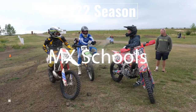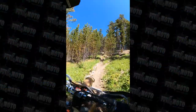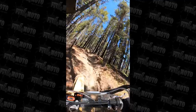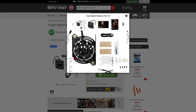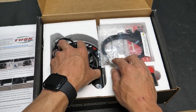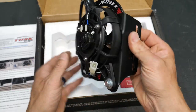That's all pretty handy stuff to me - it looks like it's easy enough to install. I've never installed one of these before as I'm new to the whole hard enduro bit. A few things that grabbed my attention with this digital fan kit: the airflow is 130 cubic feet per minute, which will quickly cool your radiator, and it only pulls 15 watts while it's running. On top of that, it really is an all-in-one kit that comes with everything you need to mount it and have it up and running in no time.